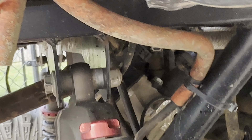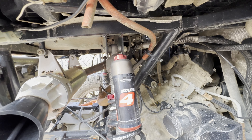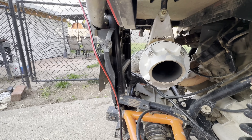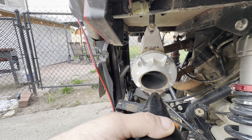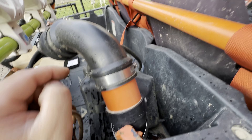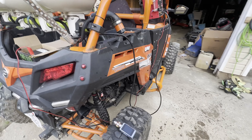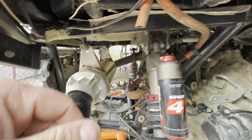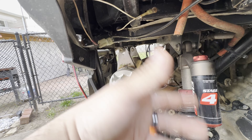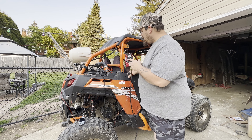The injector has been leaking — that's kind of the pros and cons of a 3D printed intake. I'm going to pull that injector out and silicone it. Other than that, my airbox here wasn't leaking — no leaking there, so that's a plus. Just those two things, which I figured the exhaust would leak anyway; the stock exhaust does it too. You could put a new donut in and it'll seal up for maybe a ride or two, but then it'll be back to leaking. Don't worry about it unless it's really loud.